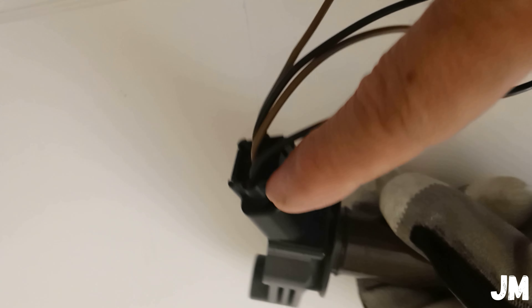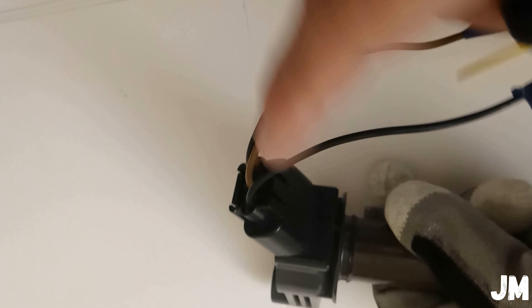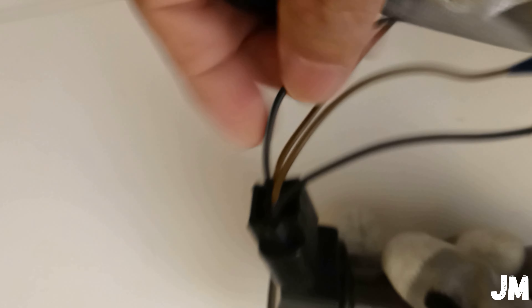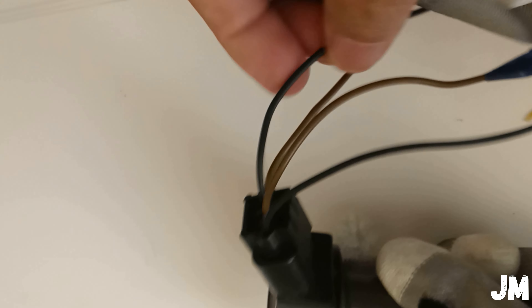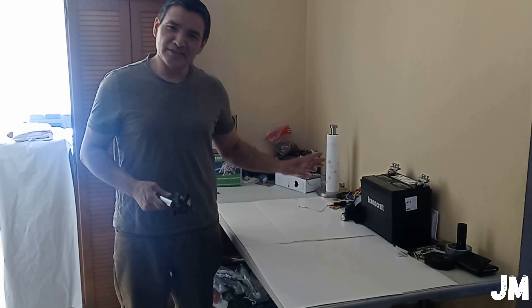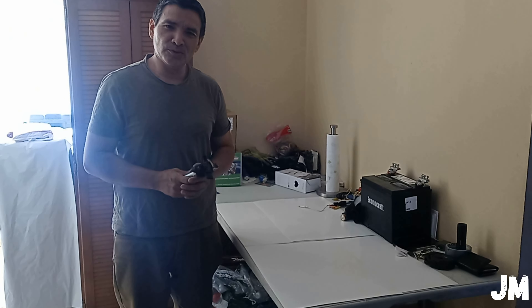That's enough — you can see the ignition coil pack is firing very strongly with no problem. You also need to know the wire diagram, because otherwise you won't know what each pin does and what every wire controls. Also, be aware of the specs and parameters from the manufacturer for that specific year and model, since things change every few years. Wire number two, by the way, is shared by all the ignition coil packs on these Toyota vehicles.